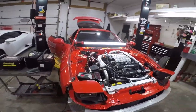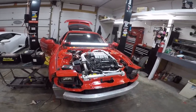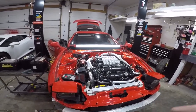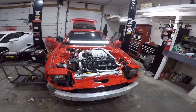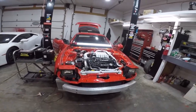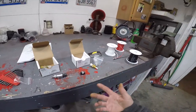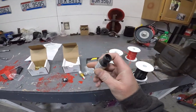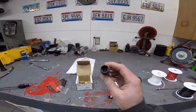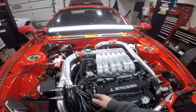A buddy did me a favor and remote-tuned in — we got it to somewhat idle, but it's not right. The AEM Series 2 is supposed to be plug-and-play, but it will not work properly with the mass airflow sensor — it needs a MAP sensor. It keeps defaulting back to speed density every time we change anything. So I got an AEM MAP sensor and intake air temp sensor that you wire in yourself. The signal wire goes to the top of the MAP sensor, ground on the right, and you hook it to vacuum after the throttle body.